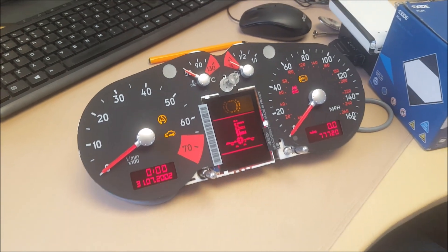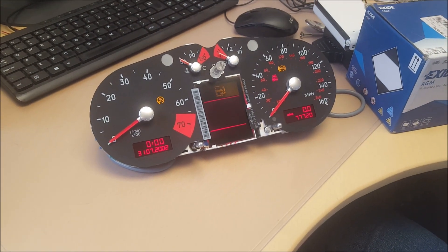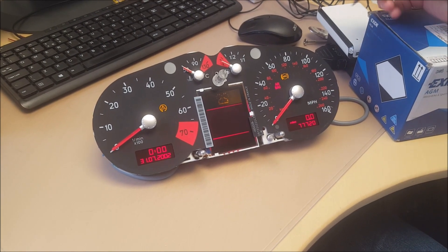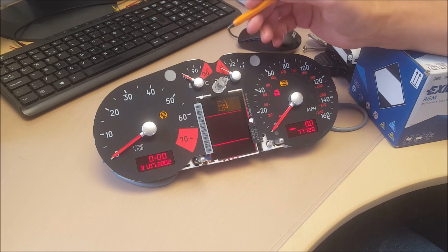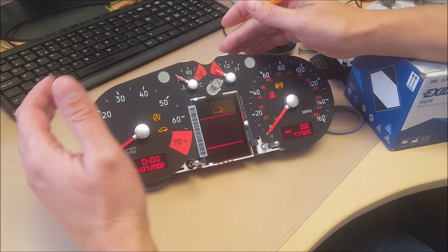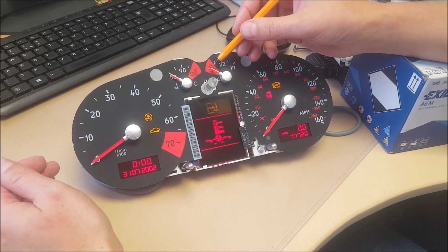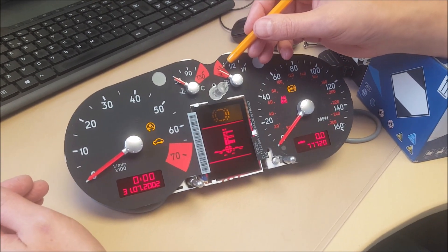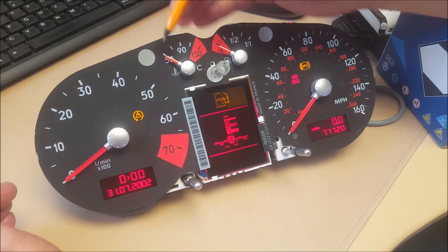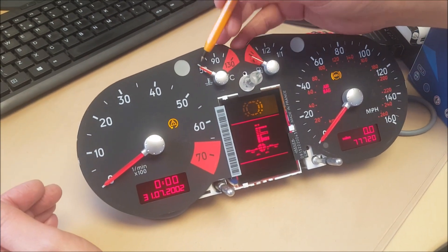When you're doing this in your car, the easiest way is to have the car with very little fuel, with the fuel light on, and just put the dash back in the car. The ignition on and put the needle at the R mark. Have the engine cold and put the needle at the 50.